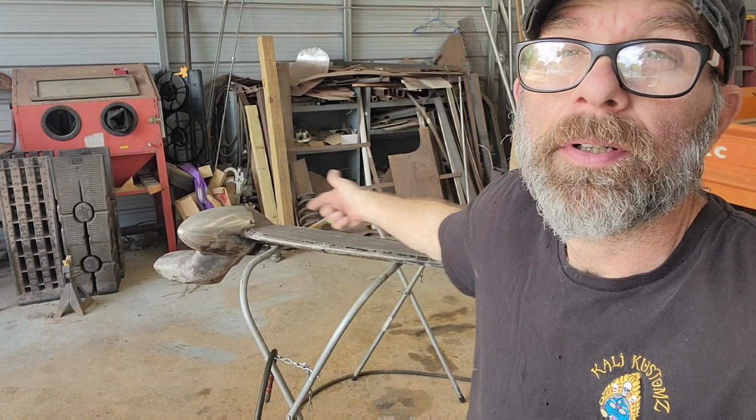This is what I used on the entire frame. Anywhere that was really rusted, like pitted, I cleaned it all up, wire wheeled it, used the acid metal prep, and then put this on with a chip brush. The inside of the bumper I actually sprayed, so it's sprayable too, right out of the can. You need like a 2.0 tip to spray it like a primer gun, but it works great. I'm going to let that set up, and then come back and coat it with this.